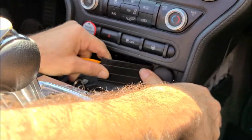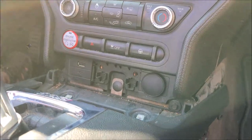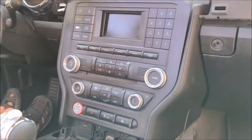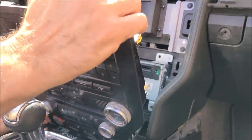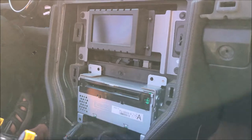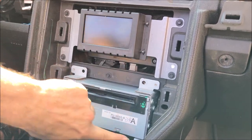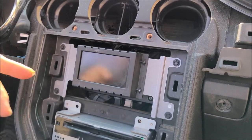Pop up the cover underneath the AC control. As you can see, there are two bolts there and two on the top. Once you get those four bolts out, all of the mounting bolts for the radio CD player are exposed — four for the CD player radio and four for the monitor, all size 7 millimeter.